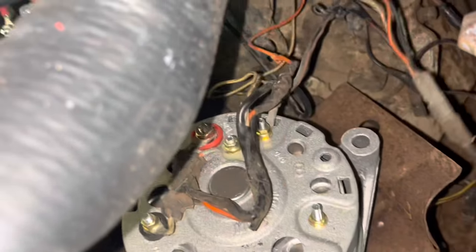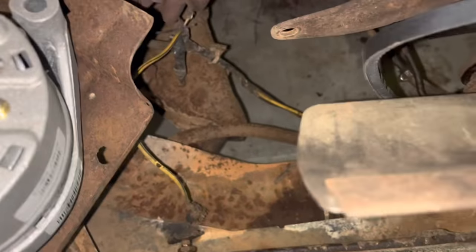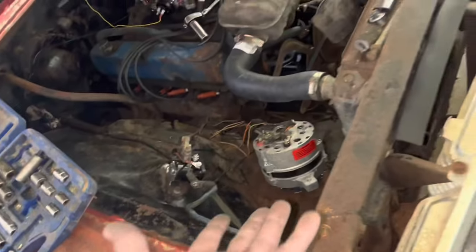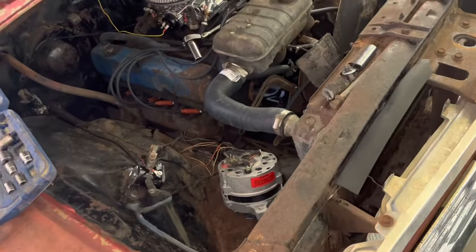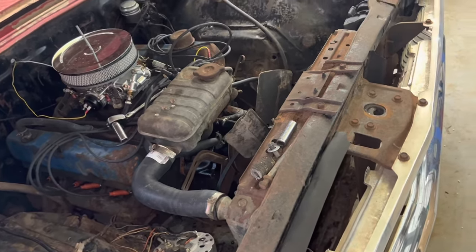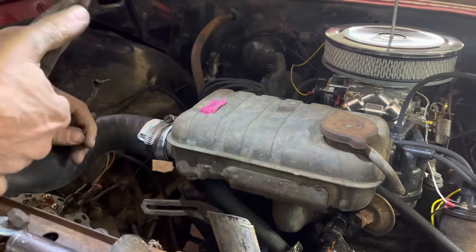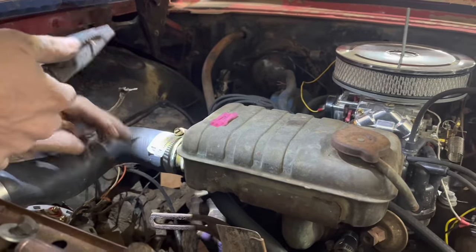While I was digging in the wiring, this wire right here, your tan wire and your orange wire, goes down underneath the alternator. Now that the alternator's out of the way, it's been cut all the way through. So I'm going to reconnect those. That's probably our issue in the first place, but you can't have a new water pump and carb without a new alternator, right? It's like having the shoes and the belt without the purse, right? You know what we do around here. We just butt connector it and crimp it. That's all we do.